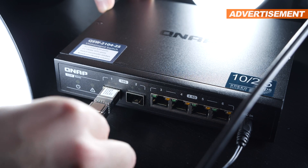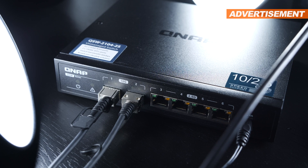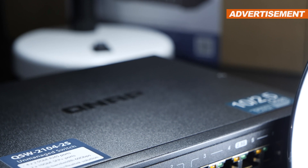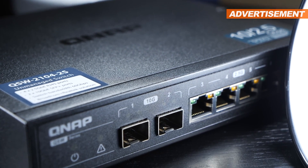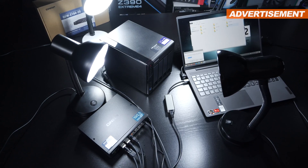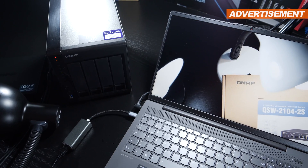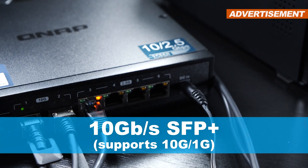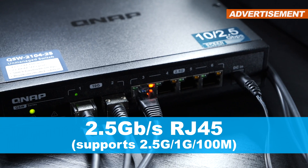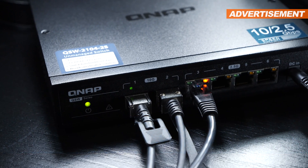But what's up with these specified speeds? Be it 1Gbps, 2.5, or even 10Gbps — do not expect your provider's internet speed to magically increase by simply connecting a switch. The bottleneck remains your provider, or radio tower, or whichever way you get your internet. When talking of 2.5 or 10Gbps, we are basically only talking of speed benefits within our own local networks, which can be even more important actually, especially if you have to handle huge file sizes. And just to let you know, 10Gbps can run at either 10 or 1Gbps. Those 2.5Gbps based on RJ45 can run at 2.5Gbps, 1Gbps, as well as 100Mbps. It's all backwards compatible.